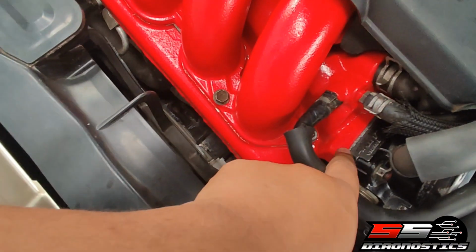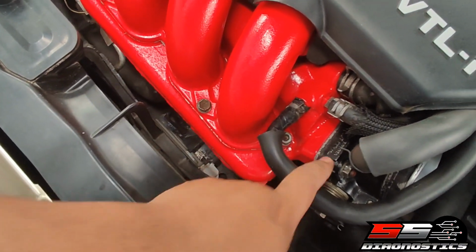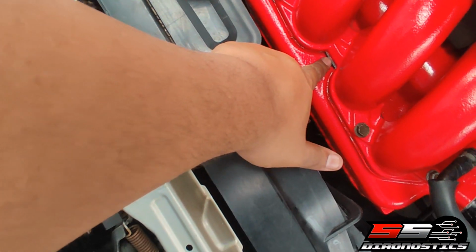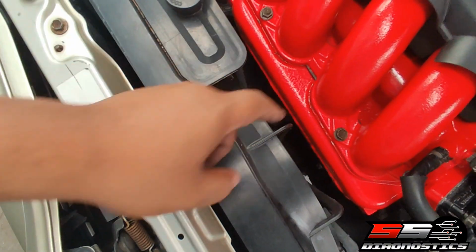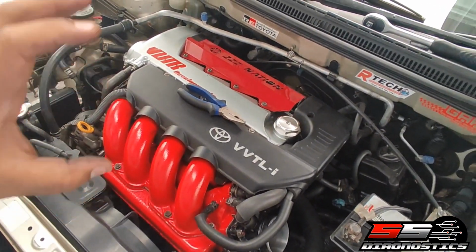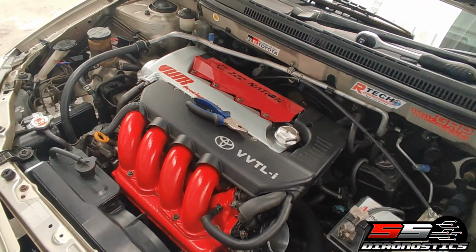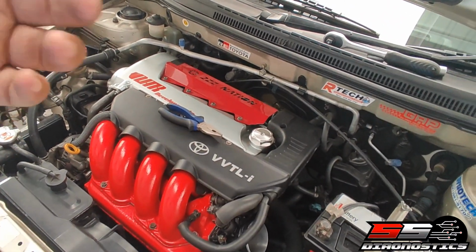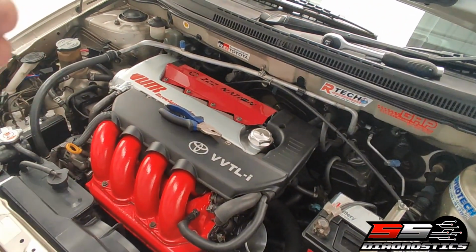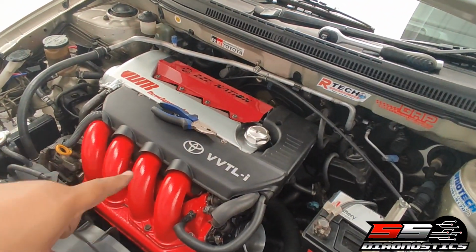And then if you can see between the intake is the head and the throttle is back, this grey part, that is the thermal gasket. Right? And then that's also part of the thermal gasket, and then there's another thermal gasket that goes against the head. So the normal gasket that normally goes against the head, between the cylinder head and the intake, is a metal gasket. So we swap it out for a thermal gasket. It's a certain material that basically reduces the heat transfer, so your intake will stay cool.